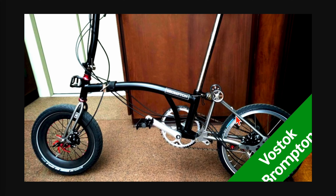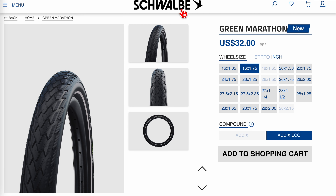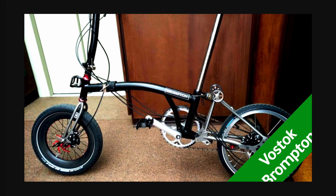With this new 1.75-inch size, you might be able to mount it without replacing the fork and triangle, but this is not certain. I haven't taken any measurements — I would have to remove the wheels to do that. All forks and triangles become wider as you go down, and the smaller 305 rim will pull the tire center lower, so it might just fit inside a standard Brompton frame — but I can't guarantee it.